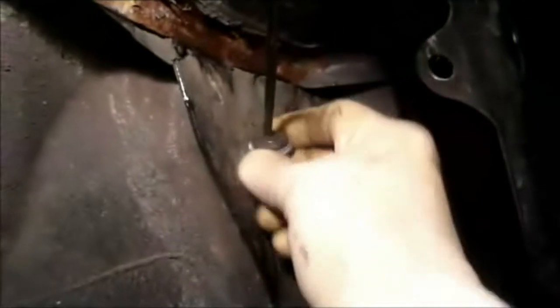I just want to show you this here — there's a little tiny grommet that goes through here. And that grommet you have to rip out with a pair of pliers and just cut it off because we're not going to be reusing it. The new cable comes with one on it already. So you can just cut this off and remove it because we don't need it any longer. Grab a razor blade and cut that off so it doesn't obstruct anything when it goes through there.